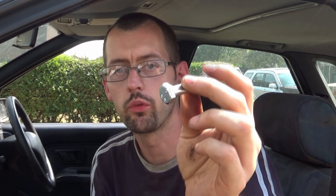I've also got pinch bolts which are looking worse for wear — slightly rounded on the nuts, a bit tricky to get off — so I've got brand new bolts as pinch bolts as well. I've got a place near me which is called Westgate Fastenings. If you're in the Great Yarmouth area you'll know what I'm on about. You literally take anything to them, bolt-related or nut-related, and they'll find it and match it to the length and thread count. They're fantastic. These new pinch bolts are high tensile, so the strength aspect is covered. I did talk to them about what they're going to be used for and they know their stuff.